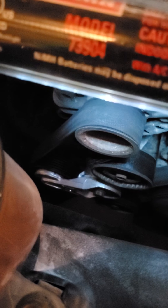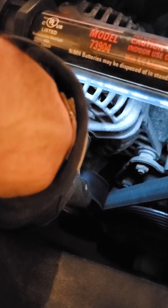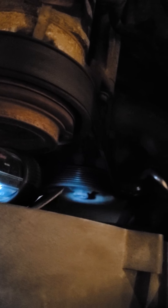The new tensioner is on there — it's nice and shiny, might actually be the shiniest part on this truck. Make sure the belt is routed correctly; you'll know if it's not because it'll have slack in it. The hardest part was getting the smooth side lined up evenly in the center of the pulley. Make sure all your belt lines up and is in the grooves on each of the pulleys all around the alternator and down at the tensioner pulley. Go down and check all the belt positions — don't assume everything stayed on correctly.